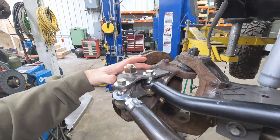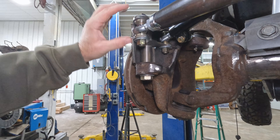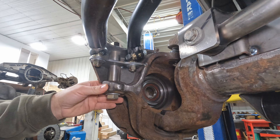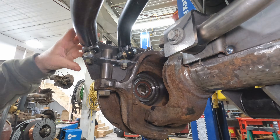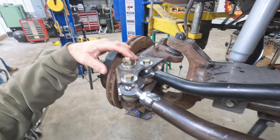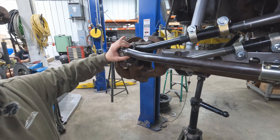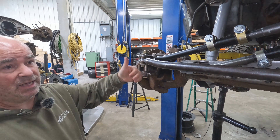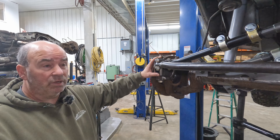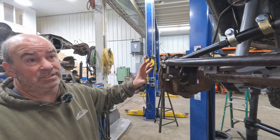We've added a lot of work into the knuckles — both the tie rod and drag link are mounted in double shear, tied into the factory casting for maximum strength. We're adding extra plates to maintain strength while changing the pivot locations: repositioning where the drag link mounts to keep maximum steering angle, and raising the tie rod mount as high as possible. All of this is engineered to make this system work extremely well on-road and off-road, and it's about as easy to install as an install like this can be.